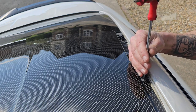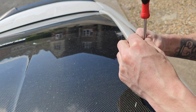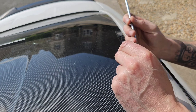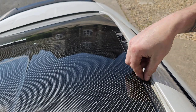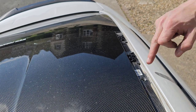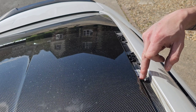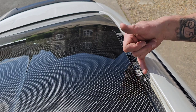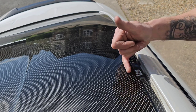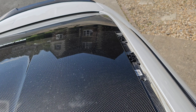What you've got to be careful of as well is that the threads these go into are on a plate, and that plate can slide and move, so you don't want to put any pressure on. What I will do is get some lacquer - I'll do that now actually and just seal the edge of the carbon. What I don't want is water or moisture from the inside getting between the carbon layers, because then you get frost in round here as the layers separate.